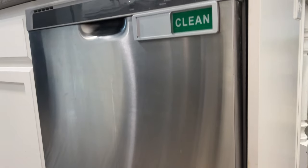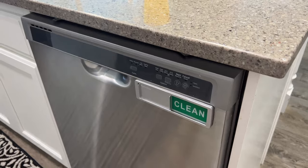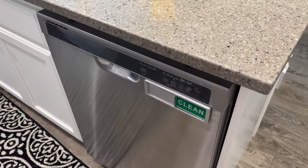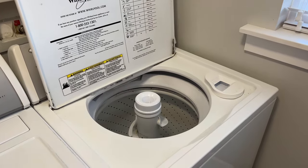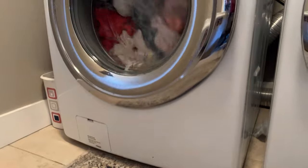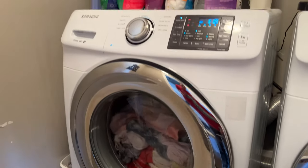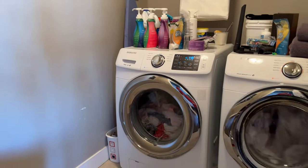It's helpful to note that most dishwasher manufacturers recommend that you keep your water between 120 and 140 degrees, so that may factor into where you set that dial. Also, most North American top loading washing machines rely on the house's hot water temperature for their hot water cycles. Front loaders and washing machines with an extra hot cycle, on the other hand, often have a built-in water heater. So these are all things to consider when you're trying to select the best temperature for your home.